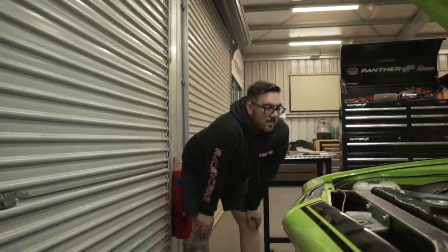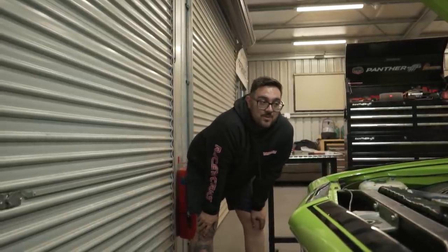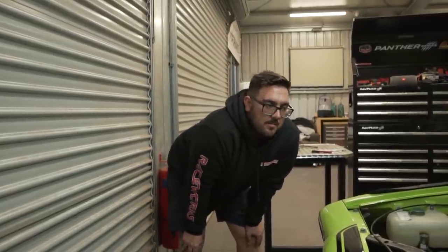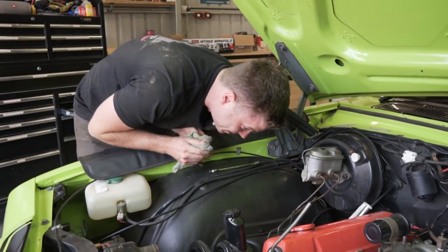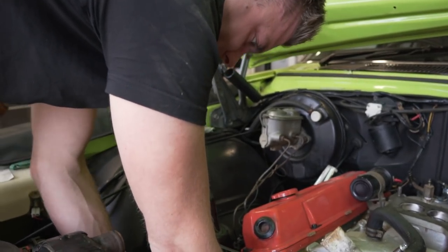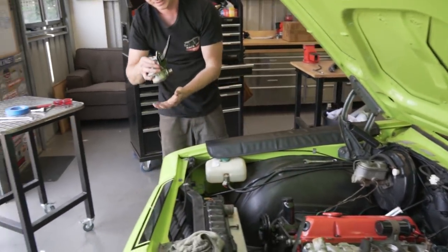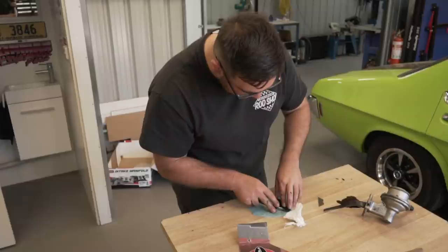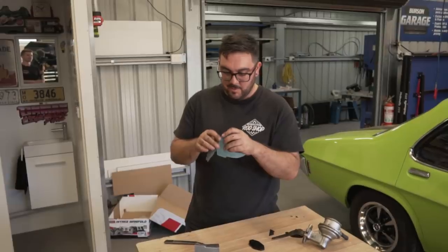Now we need to move on to the fuel system. We've had to remove the original mechanical pump that works off the cam lobe on the engine and just blank it off. We created a blanking plate with some flat bar, about 5mm thick, loaded it with RTV and capped that off so oil doesn't come pouring out. Michael struggled to get the pump out - it was so long that he had to actually drop the power steering belt off to be able to get the arm out. Other than that it was easy. Nath made up a plate using gasket paper, made a gasket, and slapped it on. Hopefully it doesn't leak - we'll see.